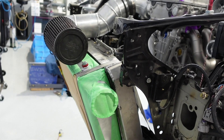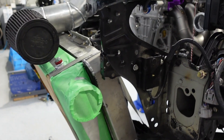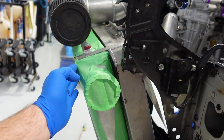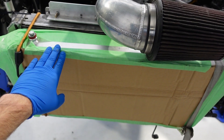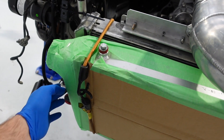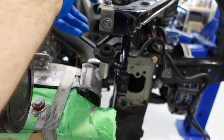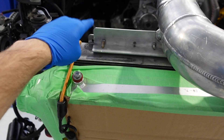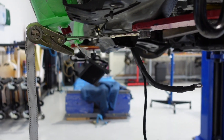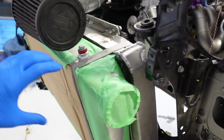We're looking at the new cooling system mock-up for the car. Now that we're forced induction we have to add an intercooler. We've got the radiator sitting in its original position from the V8, and our plan is to run the intercooler up close to it on the same angle — that's the easiest way to package it. We're using a same-size intercooler core as a mock-up while we fabricate a new one with custom end tanks, bringing the piping up on each side directly from the turbo into the intercooler and out to the throttle body. We've still got plenty of clearance to the bottom of the car and will probably mount it off the crash bar.